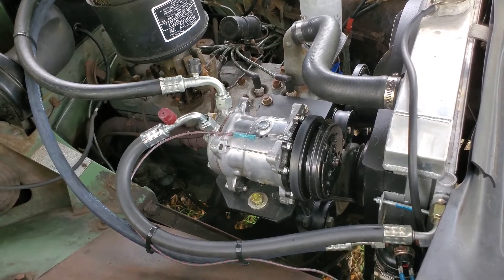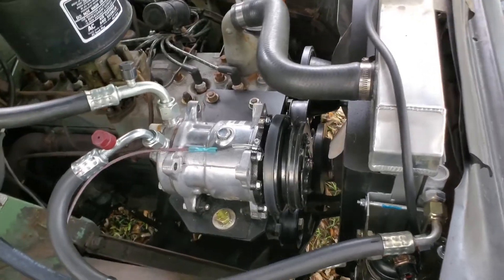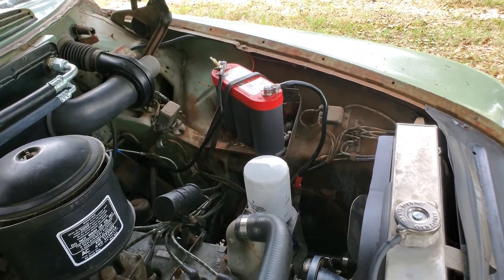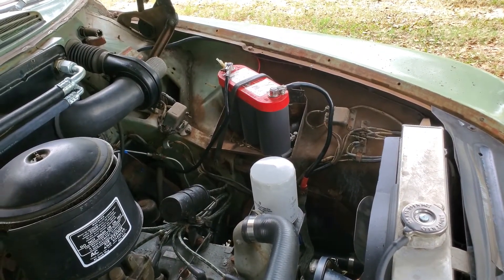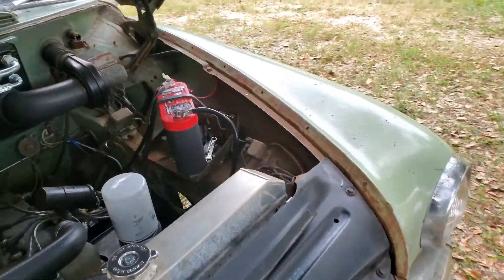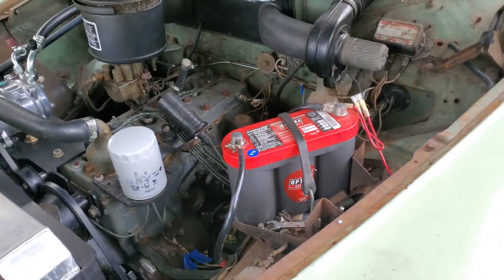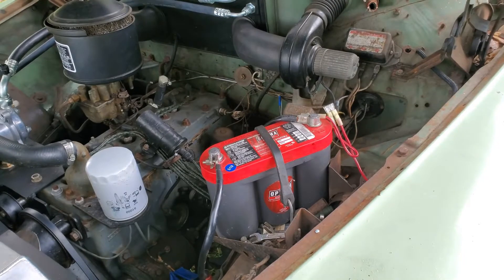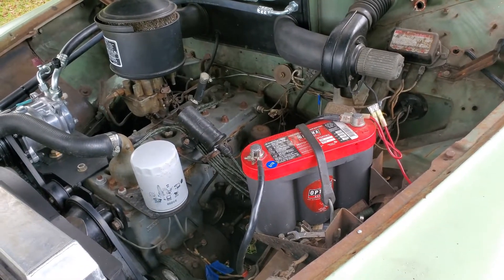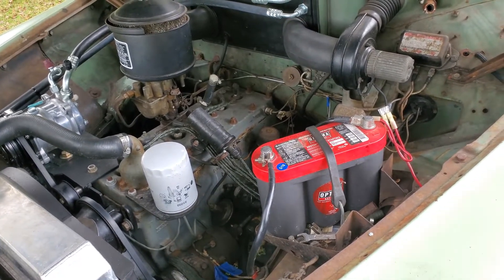Because it's an electromagnet, it's really only affected by amps, not volts — that's how you can get away with it. When I was experimenting, I took it and set it on the battery, put the case on the positive terminal and the trigger wire on the negative terminal to see if the polarity would reverse and it would work. It did — just on battery voltage without the car running — and the clutch would click and engage.